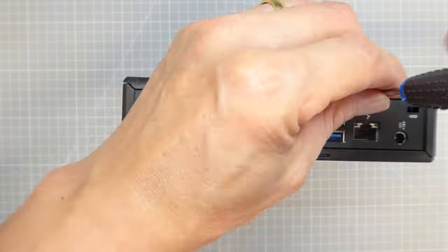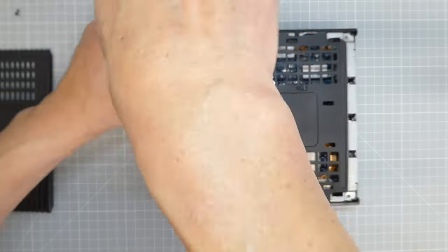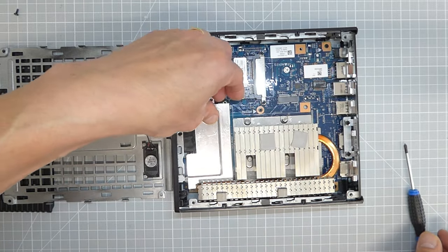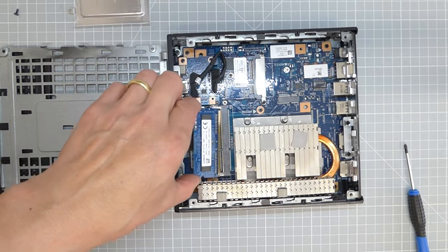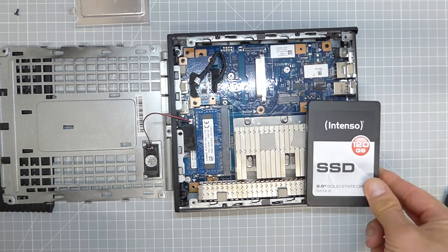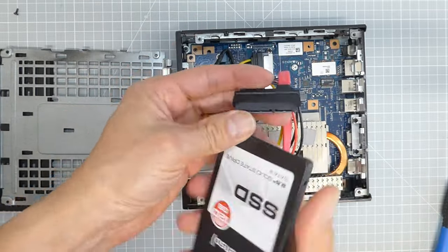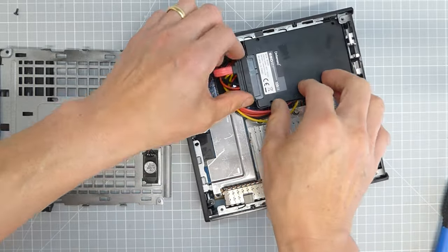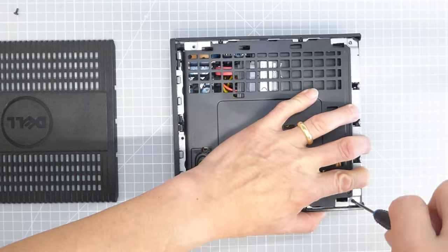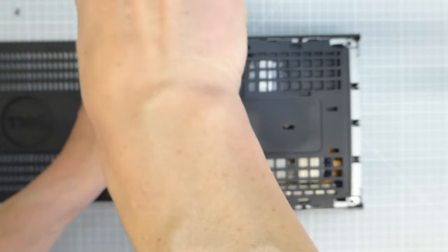To get this up to a usable specification we'll need at least a 128 gigabyte SSD and, if we can run to it, maybe a second 4 gigabyte memory stick. Luckily I had some suitable memory lying around so I've dropped that into the spare second memory slot found hidden behind the metal shielding. For the SSD I needed to buy an extension cable as the existing SATA port connection is actually soldered onto the motherboard itself. It was a bit of a squeeze to get it all into the empty space, but a little bending around and tinkering made it manageable. That gives us a 2.4 GHz quad-core PC with 8 gigabytes of RAM and an SSD main drive — a fairly respectable specification for a low-end PC.